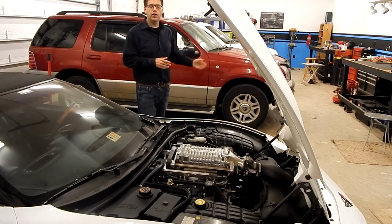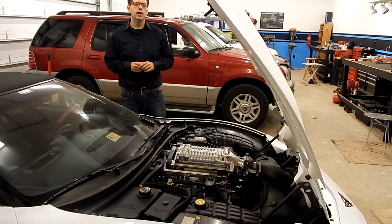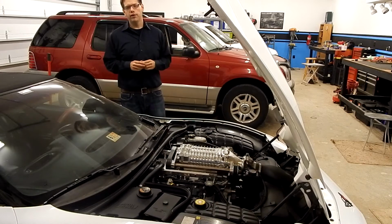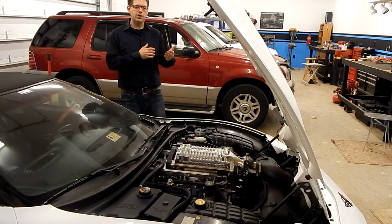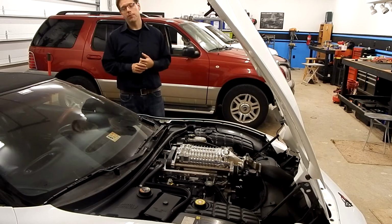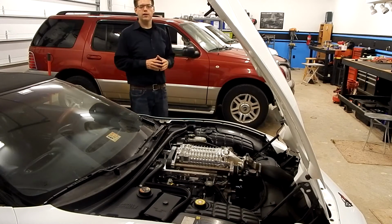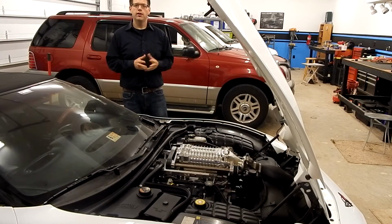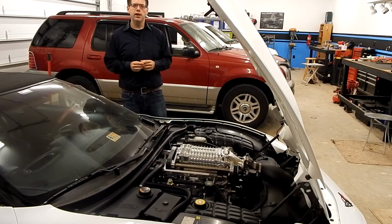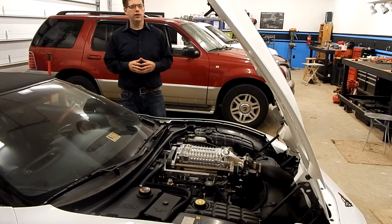We'll also be focusing on how these all-wheel drive systems work, and very importantly, the importance of having the right tire size diameter matching on all 4 corners. And along with that, I think the viscous coupling's bad in the transfer case. We've also got a Grand Cherokee back there. It's a WJ. It just got a full fluid service as well as some pretty extensive suspension maintenance. We've got those videos. They're all done, just need to be edited. We'll go ahead and get them uploaded.